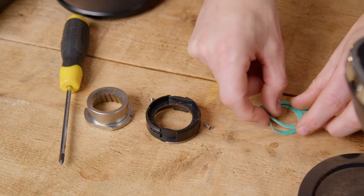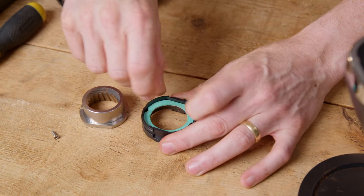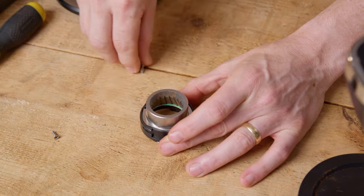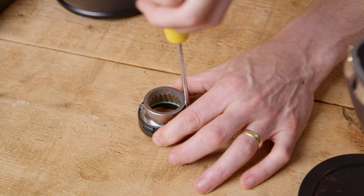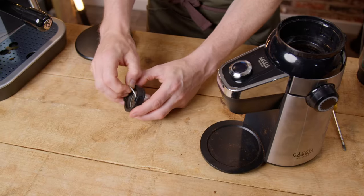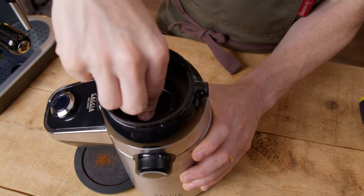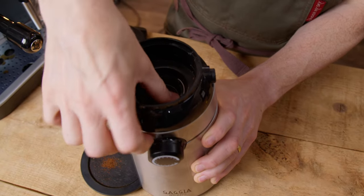That's how simple it is. It comes with three shims. I find two shims bring the burrs close enough together — I'm not sure if putting three in there may be overkill. We don't want the burrs to be touching, so I'd say start with one or two. It's very easy to do if you need to add the third. If you're not in the UK and you need to create your own shims: just remove the outer burr, take the two screws out and then draw around the burr on a very thin piece of plastic or card — about a millimetre thick, as these are about half a millimetre and I found that using two works well. Then just cut it out and trim accordingly if needs be to make it fit.